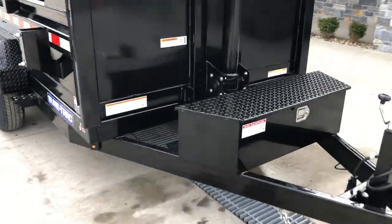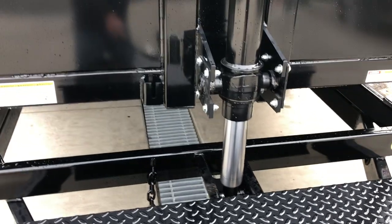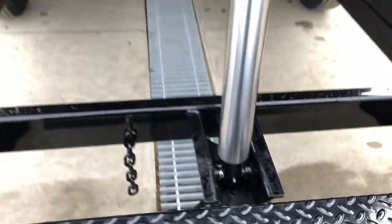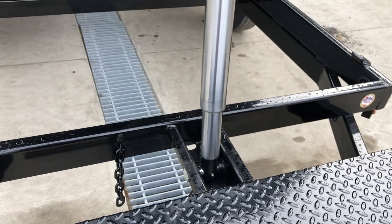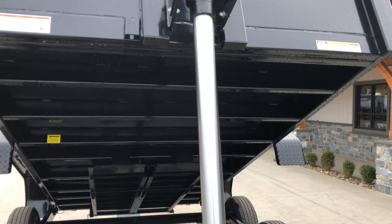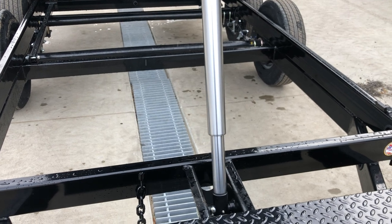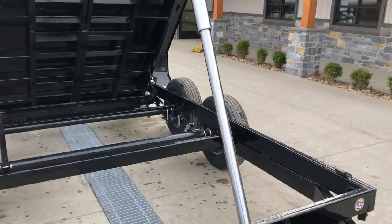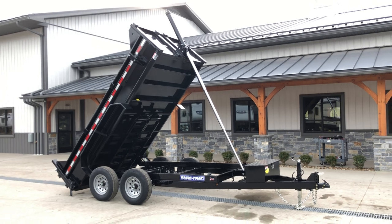Let's take a look underneath. This is a 6x12 — that's an inside bed dimension. Some guys ask if there is additional bed length, and generally the answer is no; 12 foot is 12 foot. There are three grease zerts on the telescopic cylinder. Right now we're in first stage, which is the slowest — you'll hear it kick to second stage and get a little quicker. In stage one, maximum lifting capacity: even if you're loaded front-heavy, the telescopic hoist is still going to pick that load up. When we get to third stage, it gets even faster. This achieves roughly a 45-degree dump angle, so you should be able to get out pretty much any material, including sticky clay.